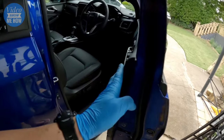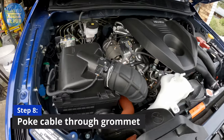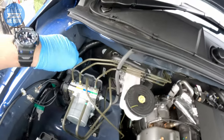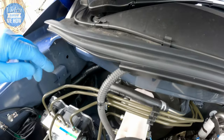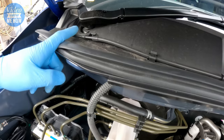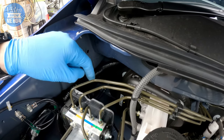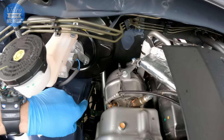Once you're done, pop the bonnet. What we're looking for is the wiring loom down the bottom there — we want to snake it up. This is the big grommet that we want to go into — the main grommet through the firewall into the cabin — which is what we want to tap into, because this terminates right at your accelerator pedal. That's where we use that last part of the wiring loom.